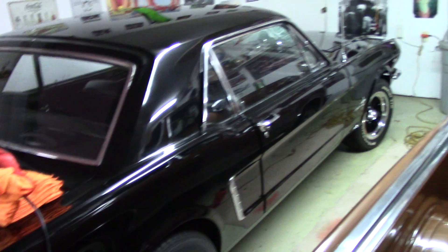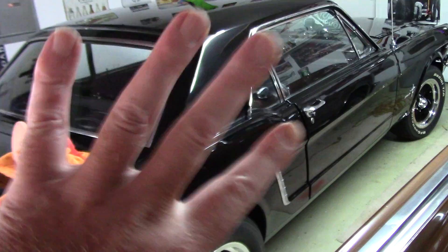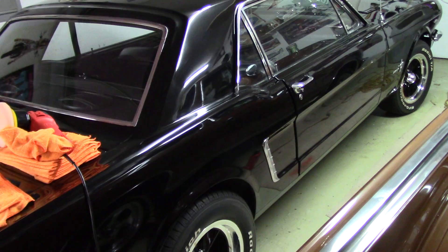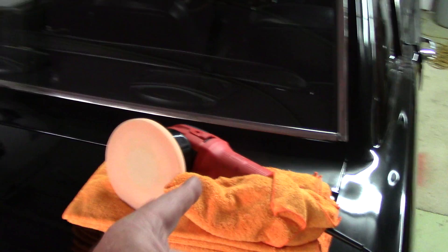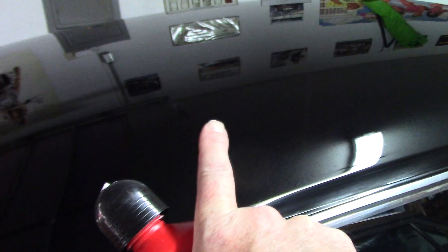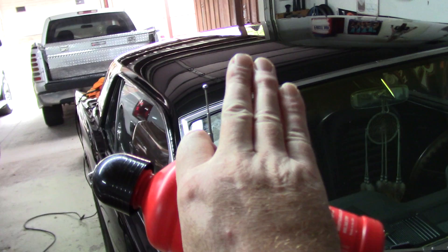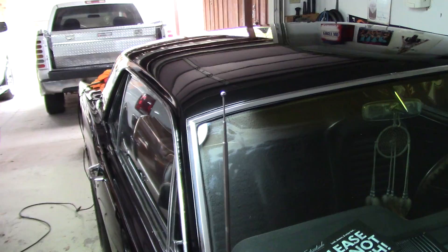What he wants me to do is get all the old spent compound out of the creases. I did a test panel on the hood, showed it to him, and he absolutely loved it. The paint is hazy with swirls and wet sanding marks, so I'm using a Griot's orbital polisher with an orange pad and Griot's Correcting Cream as a one-step. This is working really well — it's a repaint fresh out of a body shop so the clear coat is pretty soft. The correcting cream is giving me tremendous gloss and shine, and I can get around the car quickly.